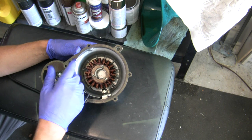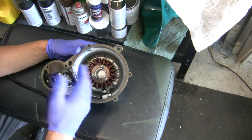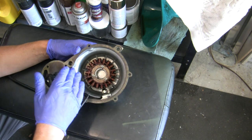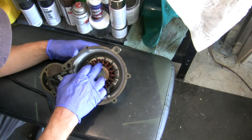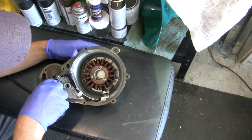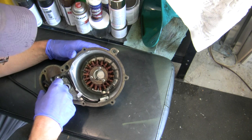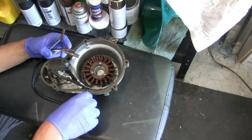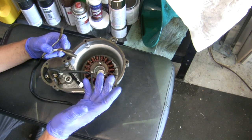You have a regulator and rectifier in the charging system that take the AC power and change it to DC, and then regulate it down to a voltage that won't fry your battery. What we can do is find out if there's a short in one of these three circuits inside the stator. On this Suzuki, you've got three different colored wires coming off of here — one is yellow, one's white with a green stripe, and the other is white with a blue stripe. Honda does it with three yellow wires.